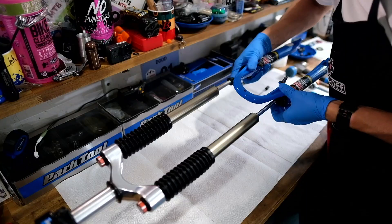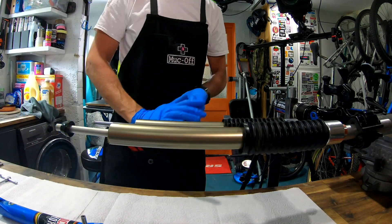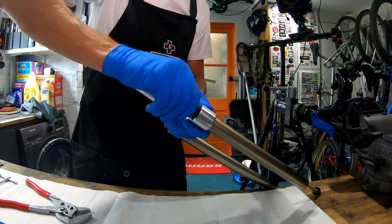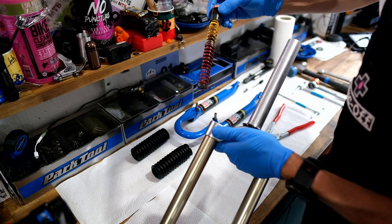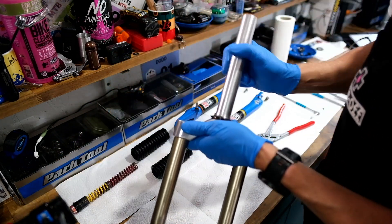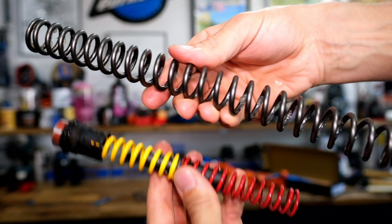I made a video fairly recently with a 1998 RockShox Sid fork — I took it apart and had a look at how it worked compared to a brand new Fox 34, because they have similar amounts of travel with similar intentions. On the inside of that old fork, it actually had coil springs, but they're absolutely tiny compared to the modern equivalent. I showed the example of a modern coil spring which takes up the entire leg — massive by comparison, yet not that much heavier. It's all about consistency.